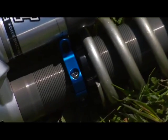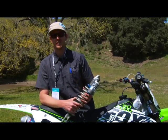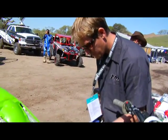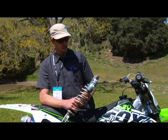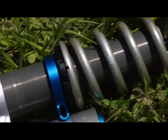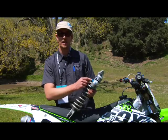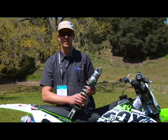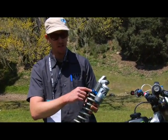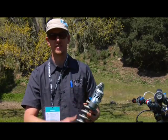Another feature of the RC3 that we're proud of is what we're calling the fast spring adjuster. We all ride at Fox, and one of the things I really hate doing is changing the preload on my shock with the jam nut on the preload ring, using a screwdriver and a hammer to knock it loose. So we came up with a preload adjust system where the spring is pinned to the preload ring, and this blue clamp holds everything in place. To change your preload, you loosen a four-millimeter Allen screw and you can rotate the whole spring to change the preload. This blue piece also rides on the reservoir, so it keeps the Allen oriented where you can get to it. You could do a half turn of preload adjustment if you want, lock it down, and you're good to go.